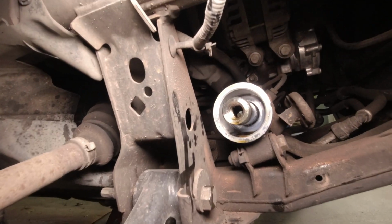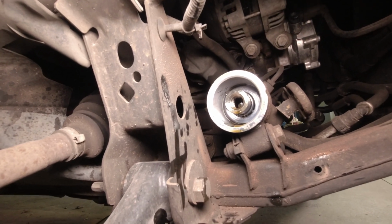Yeah, there is a bushing on the actual rack that supports the rod that you're attaching the tie rod goes through to. Yeah. Okay. And there's a seal around that is a high pressure seal that if it becomes compromised due to the bushing wearing out, allowing the rack itself to move up and down. So you're at the very early stages of that then. Okay, my question is, is the rack serviceable, or do you have to replace the whole thing? Most people will replace the whole thing. If it's a small enough leak, that could have been over the course of 80,000+ miles, which is a very low level leak. An accumulation wasn't escaping the boot, which indicates that it hadn't been leaking much.